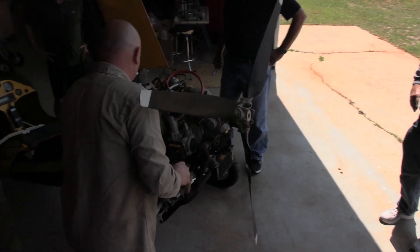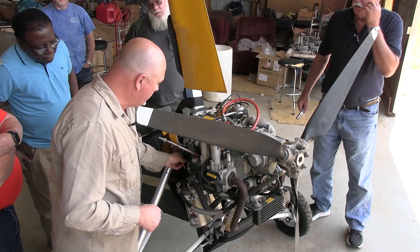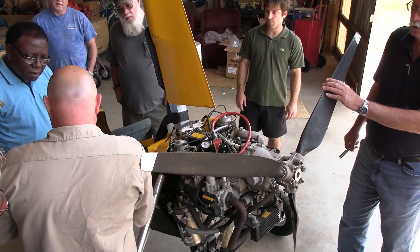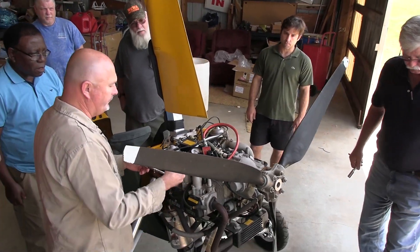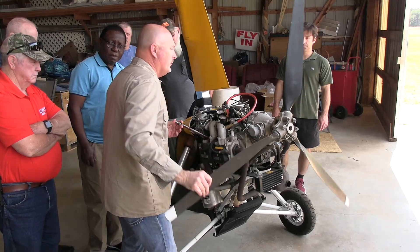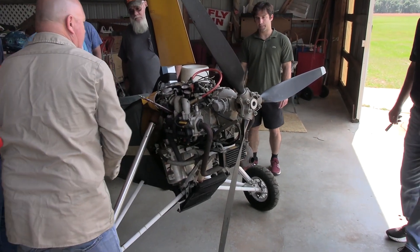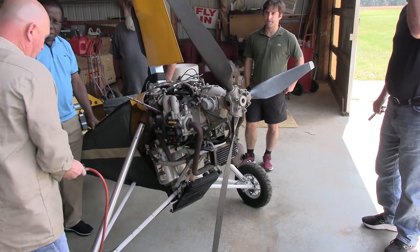I'm going to take the cap off the oil. I want to look at my oil level — we can see it's above the flat, so this particular application is already over full. Clear, Mr. Robert. Now I want to take my thumb and put it over the end here, roll the engine over — see, we got compression right there. So now I'm going to use my differential checker gauge. Note it has 0.040 as the orifice.